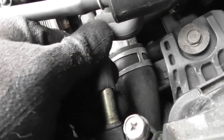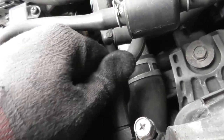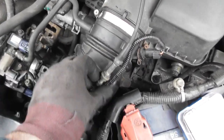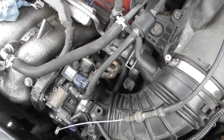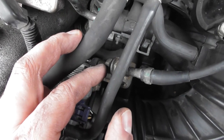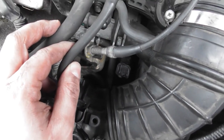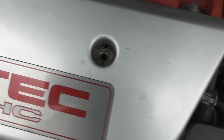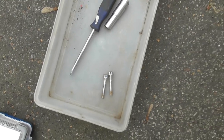Just put that connector there. This little connector goes on, and the little pipe goes on here. That's in there. Then finally the throttle cable. What you do is you push that little end of the cable in and then loop it back around. Then undo this bolt which you'd wound down, leaving the bottom one in place, and you can put the throttle cable back in exactly where it was. The 12mm does that up. Then it's just putting this cover on - drop this little pointy bit in there and put these two shiny head screws on. All back in one piece.